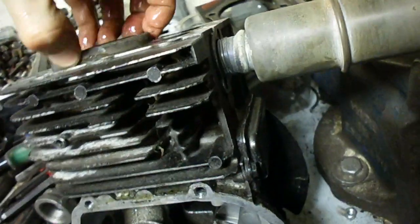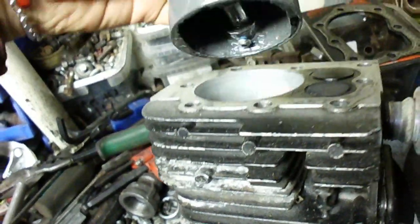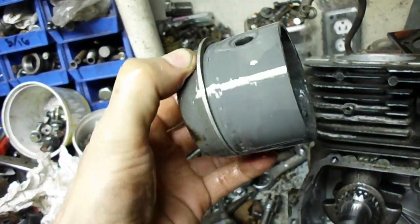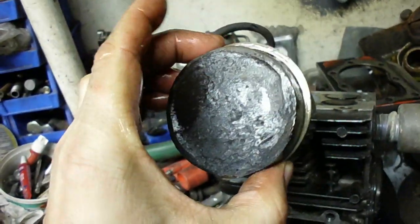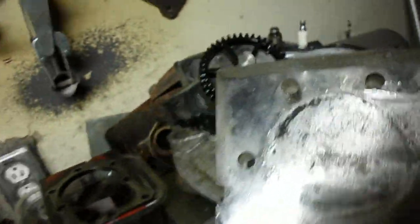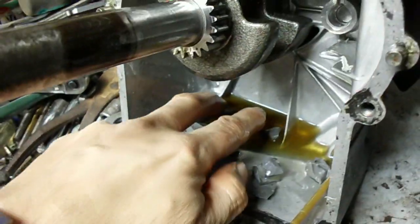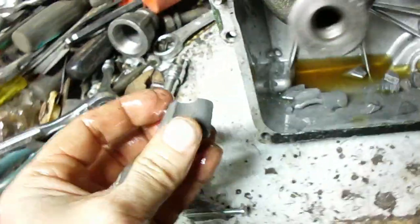I'll pull the piston out here. There's a little chunk missing out of the piston, and none of the rod left in it. At least it didn't break the piston — that's good — that means I can run it again. The top end slammed into the cylinder head; you can see this area right here with the carbon on it. It didn't break my JB Weld piston, but that rod is definitely done. I reused the top half there — sorry about the video.